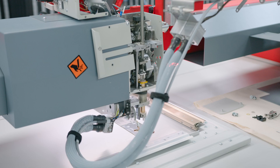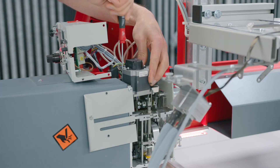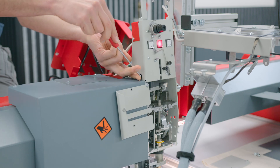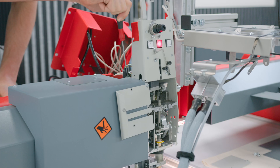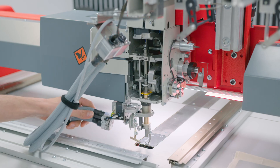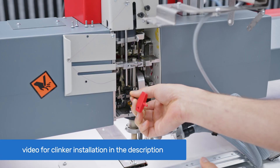Insert the needle bar and slightly tighten the needle bar coupling as needle height adjustment is required. Reattach the Z-axis motor by fastening two screws. Reattach the thread tension unit with the 2.5 mm ball head Allen key starting from the left hand side screw at the front by slightly tilting the unit. Reattach the back side protective cover. Ensure the zigzag head is at the 9 o'clock position and tighten the top screw on the Z-axis coupling. Install the new clinker.